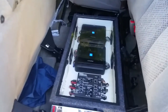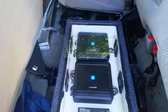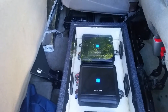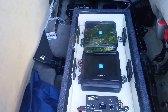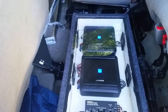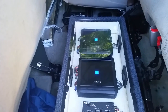Moving back to under the back seat — there's the amp rack that in the previous video was lit up at night. Two Alpine amps; these things are workhorses. One is the MRV 500, which on the test sheet was putting out over 600 watts at two ohms, which is what it's wired to. The amp closest to you is the MRF 300 — running everything else with it, very versatile, highly recommended. I've put six of these in customer vehicles and never had one complaint.